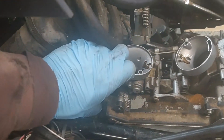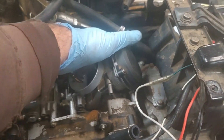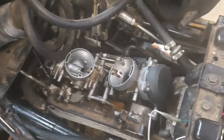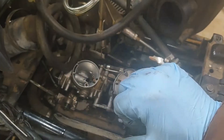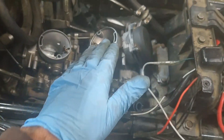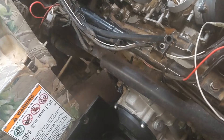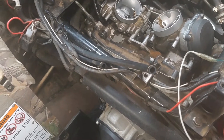The choke cable was flipped upside down on the front - it actually needs to feed in from the top instead of the bottom like I had it initially. The back one does come in from the bottom. The easiest way to get the carburetor on there is to get that front boot in and push it forward and down to get that back boot in as well. Going to see if we can get it to fire up. It usually turns over for a little bit because the carburetors are dry with no gas since we just drained it all out, so it takes a minute to pump up, but we'll see if we can get it to fire.